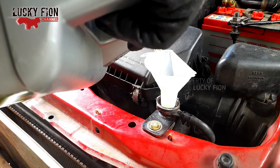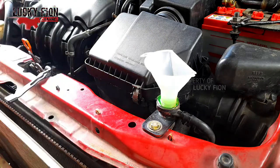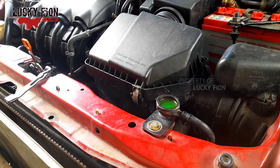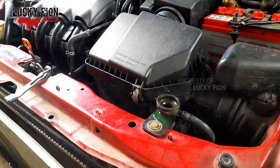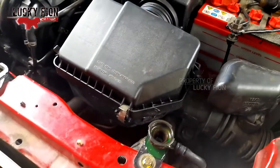After the radiator is full like this, don't close the radiator right away, bro. Then my friend turn on the machine without any load at all. The AC is turned off and the cabin lights are also turned off. To start the bleeding coolant after the engine is started, the coolant will overflow because there is a reaction that will release the air that is still trapped in the radiator. Keep an eye on the coolant level, if the coolant decreases, you can add more.